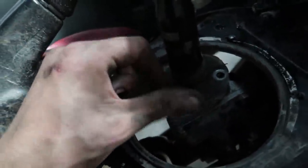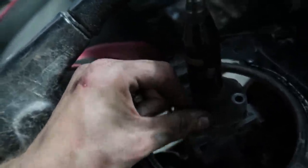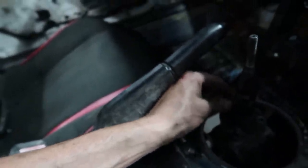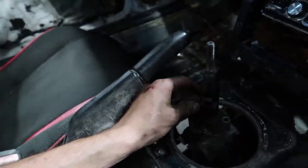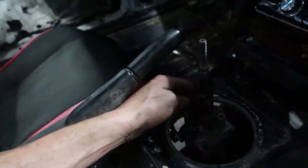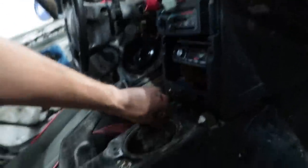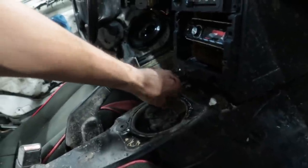All right. I'm so excited to drive this now that we've just done clutch, diff, new fluids. I actually put some thicker good stuff in the transmission as well, just to help if any water does get in there. And obviously all the new boots and seals that we've put on the shifter are really going to help prevent any water from getting in there, so that'll help a lot. Made sure there's seals and boots on the clutch fork, so no water and mud sprays up in there as well.